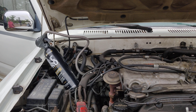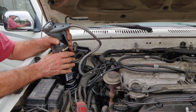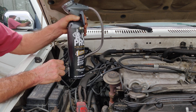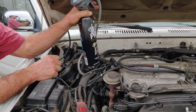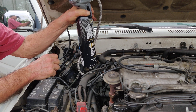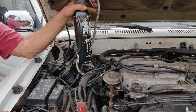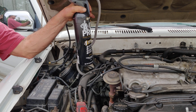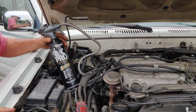I know I'm like 5 ounces short but I'll have to buy another can. Hold the can straight up. I'm up to like 28 now on the low side. I'm up here — the compressor just kicked on. I mean I've had no action before, and hopefully we have no leaks. It kicked on a little — I don't know what happened.